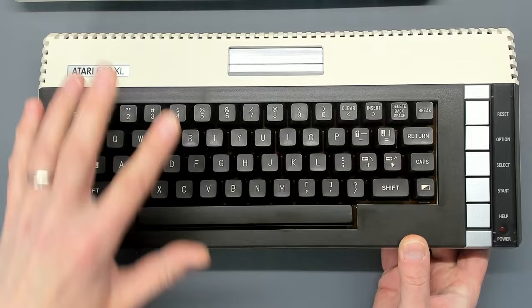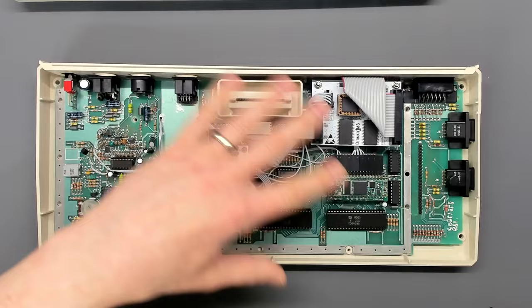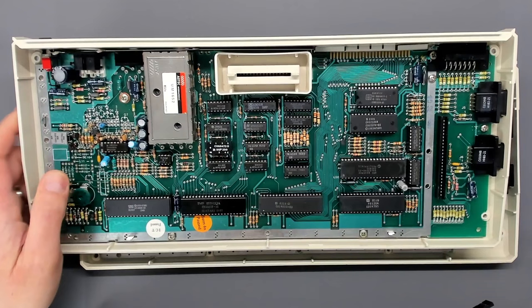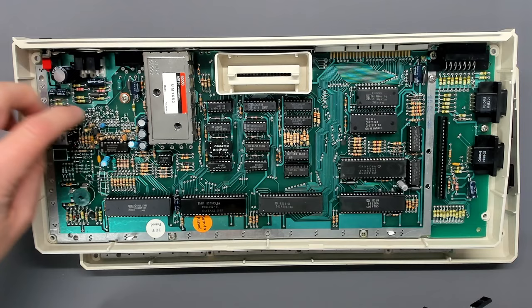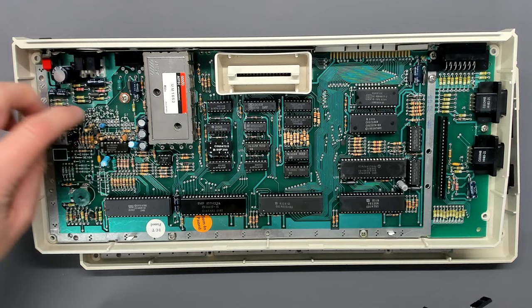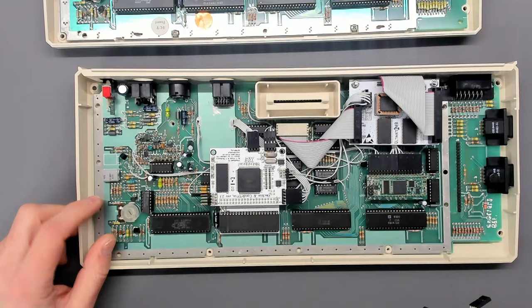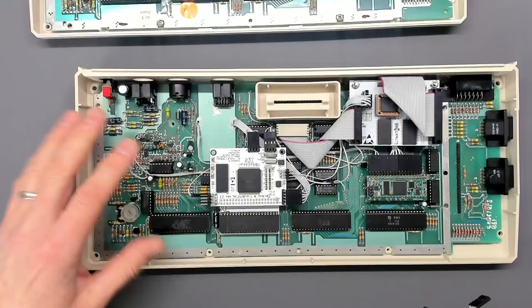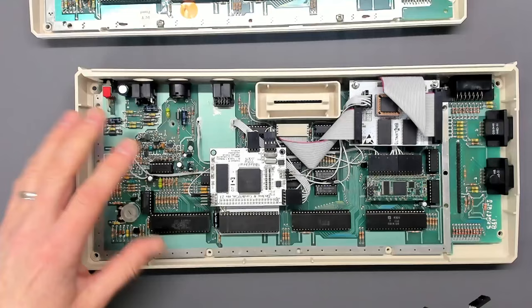I really want one of those keyboards for this machine — it's my favorite little 8-bit Atari and it deserves it. On my 600XL there's enough room for a modest set of upgrades. Comparing the customer's motherboard with mine, there's a big empty gap on the customer board: we've got the channel switch up there and some missing components. There are two areas of missing components — we'll focus on the one for the monitor output. Looking at my 1200XL in the same area, we see lots of components that we need to populate on the customer's board.